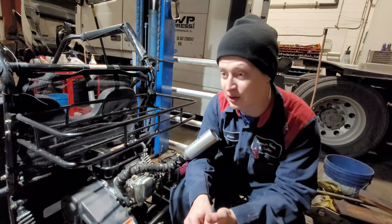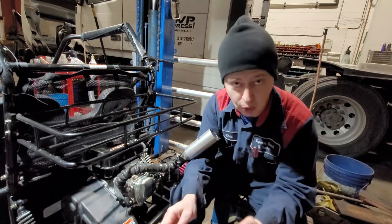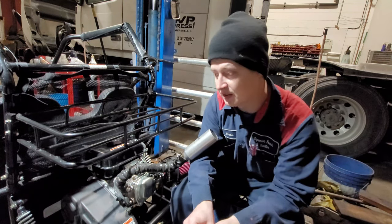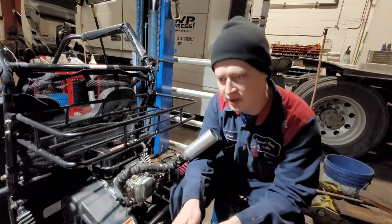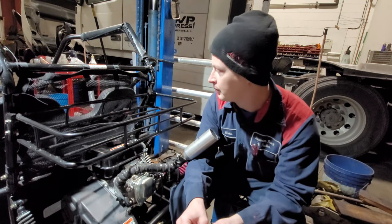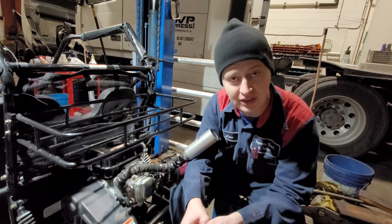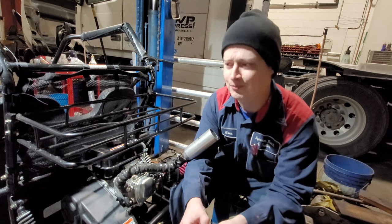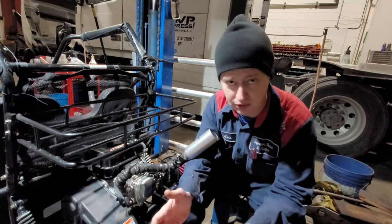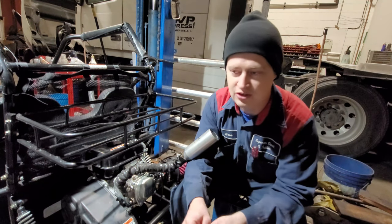36 miles an hour is a great number right now. My goal was 35, so we are one mile above what I was hoping to get. I kept all the original limiting factors so I can still make sure it doesn't go more than 15 miles an hour as intended per OEM, because the throttle will not open as much. It is a blast to drive, but it is a little harder and more time-consuming to take the governor out. It is a pain sometimes to get the little C-clip from the governor wheel. Also, you have to remember to have all the washers out of there, otherwise the engine will seize up.